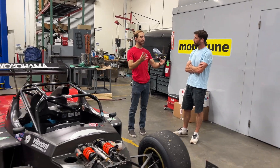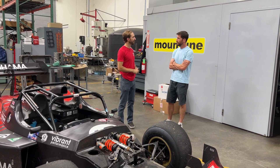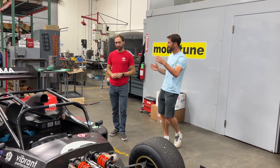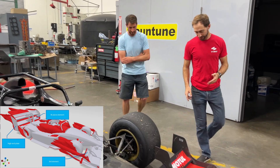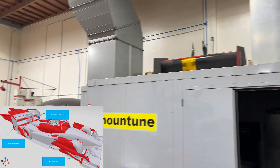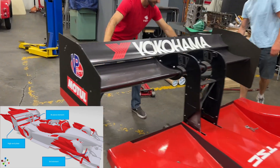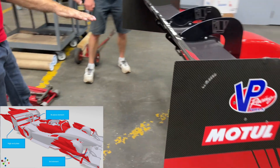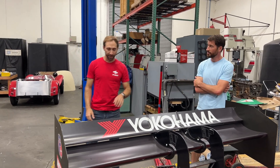If you normalise air density and speed, Pikes Peak is the equivalent of racing around at an average of 65 miles an hour — it's very slow aerodynamically. So we had massive, big surfaces, big wings. On the front we had a third element on both sides, and on the rear we had a biplane right there. We had a nice plate going all the way down to the bottom, and also a second biplane element sitting at the height just above the rear engine. Step one was figuring out what the front end did, and that was happy.